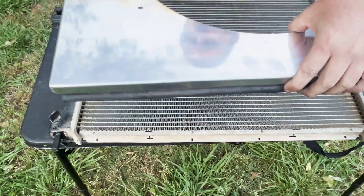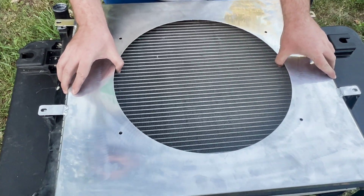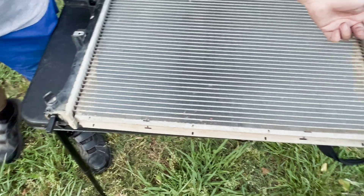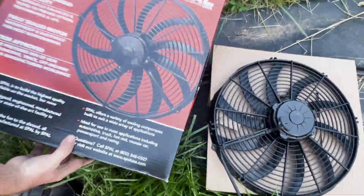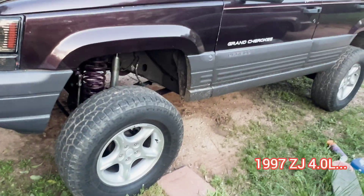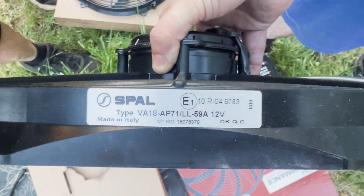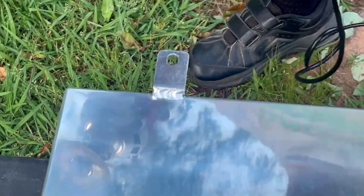Some modifications are required. It wouldn't take hardly anything for the company that made the shroud to make it work on a WK. These little plastic pieces also get in the way on the radiator as it currently is, so we'll modify it a little and make it work. We've had really good luck with the SPAL 16-inch fans on our ZJs - these have really, really good built motors on them. We'll get to cutting these tabs off and see if we can make it work out.